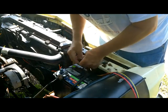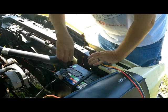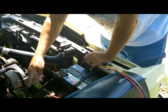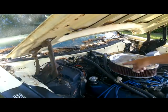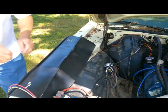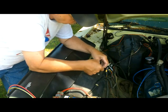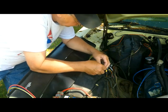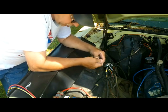So I'm going to mount these in here, one and two. We've already got our ground off of our wires hooked to the body ground. I also ran a ground from this to the body. This ground wire goes down to the engine, which then back here in the back is connected to the firewall via this strap right here. So we should be all grounded. The power — they've got a battery terminal and an auxiliary terminal, which is the fan in this case. I'm going to mount these right here because I've got these holes, and then we'll run a direct wire from our battery terminal over to those. I'm going to put a fuse on them probably.